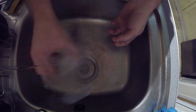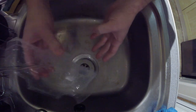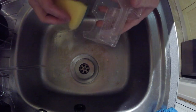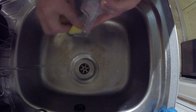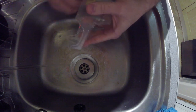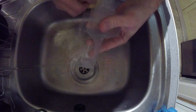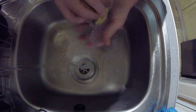Try and avoid touching it with your hands once it's dry because the oil from your skin will stop the paint adhering. Give it a really good rinse out, rinse the outside as well because any dust from the Dremeling will get into your paint finish. Have a quick look around — I'm always conscious of wheel arches because they take quite a bit of a bashing, so give them a bit of an extra key up.